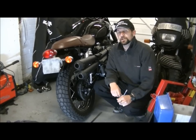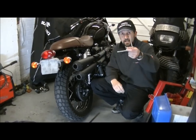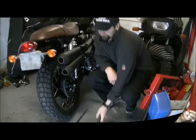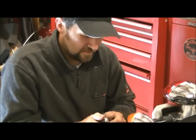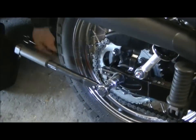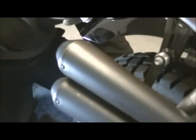I know I don't torque up all the nuts and bolts that I do, but I would say on an axle you should. And a little 8mm socket just to adjust the actual wheel itself. So come on over, let's get stuck in. First thing: torque wrench or ratchet onto undo mode on the wheel axle, and then use the 19mm ring spanner on the end of the axle this side.